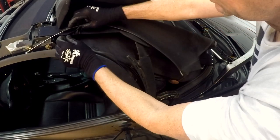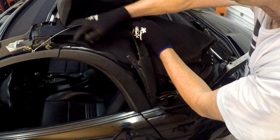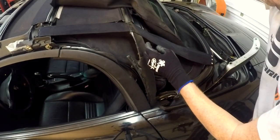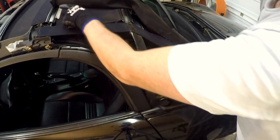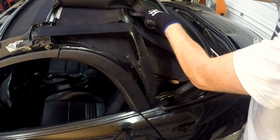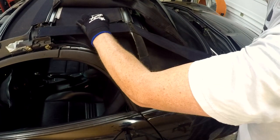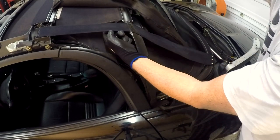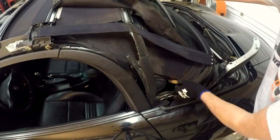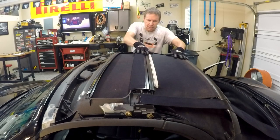Once that's free, there's another similar rib that's wrapped around here and you just slide it up. You can see here's the rib and that's the slot — you'll see that when we go to put it all back together as well. Once you do that, there's a velcroed strip which goes around this bar right here — undo that. And then on the other side there's a rib we've got to pull out of this slot and another rib out of that slot. Also take a look underneath at all this dirt on it and the inner headliner — we're going to clean all that up before we put the new top on.